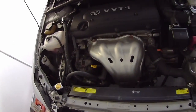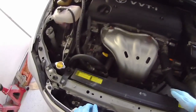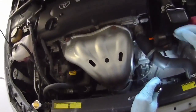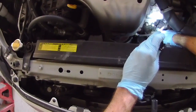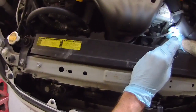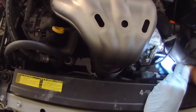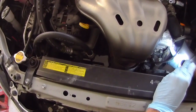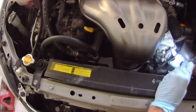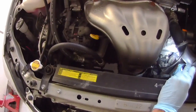The dealer will tell you — or some of the troubleshooting I've seen from dealers says — to lubricate your clutch pedal or blast lubrication on this joint over here because it gets rusty. The real issue lies within the bell housing of your transmission. This is your slave cylinder for the clutch. Inside, there's a pivot where the cylinder has a piston with a rod that pushes on the clutch release arm, and that arm is making noise inside the bell housing because it's pivoting on what I think is a metal ball-type point. When lubrication there is lacking, that pivot point starts making noise.